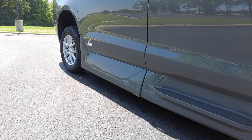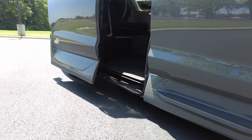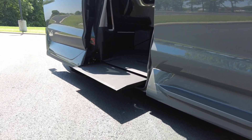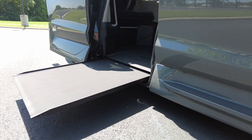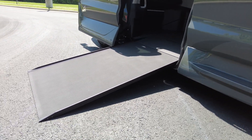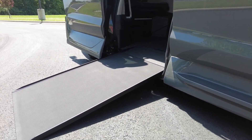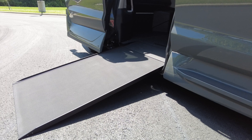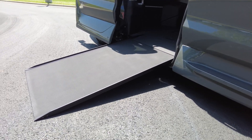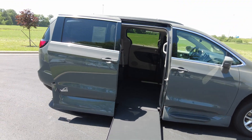Let's go ahead and do it in the opposite position — the door will now open and the ramp will come out. The beautiful thing about that in-floor ramp is it's out of your way; it's not blocking any view, and it doesn't rattle when you go down the road. Those ramps that fold up into the van — they rattle, they're in your way, you can't see — just not a pleasant experience. Pretty slick operation. Again, 30 inches wide and a thousand-pound capacity on that ramp.